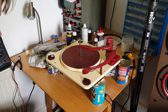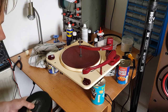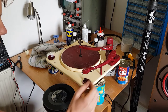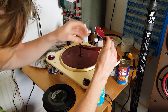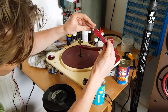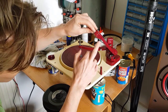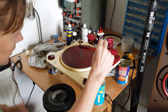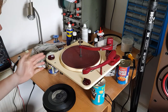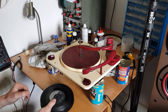I've replaced the wax capacitors in the valve amplifier as well as the smoothing can, and it's now working fine. The last job was to replace the cartridge. There was a crystal cartridge originally fitted. I did have a spare gold ring MX4 kicking around with a new stylus, so I thought I'd put that in. I've also replaced the signal cable with a screened cable as it was picking up hum from the amplifier, so that was an improvement, and I fully serviced the record player. It's sitting on some baked bean tins at the moment.